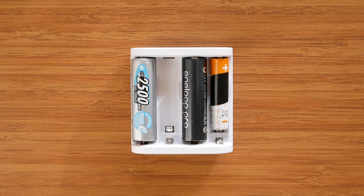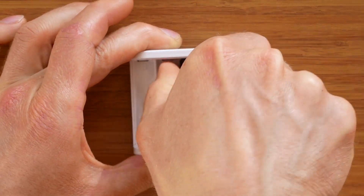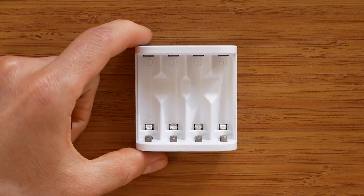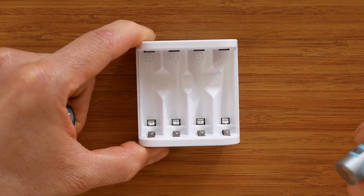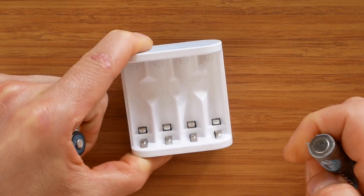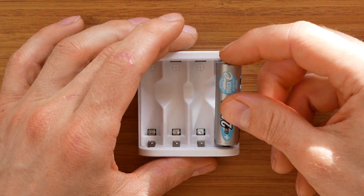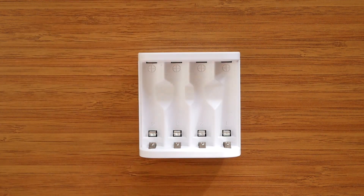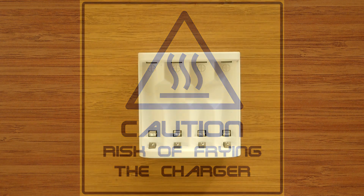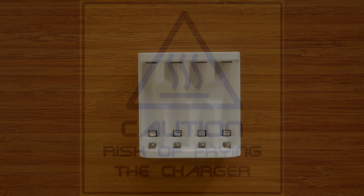At this point you might be wondering why I am not actually using the charger in the video. Well, that brings me to a bit of a warning. While testing the charger, I was trying to see if and how the reverse polarity protection works. It's impossible to charge a battery the wrong way around since the plus contacts on the charger are slightly recessed, so if we insert the battery that way, it simply won't work because there won't be any contact on that side. However, to test the feature properly, I inserted a small metal plate between the minus side of the battery and the plus contact, but unfortunately the A4 stopped working afterwards. I'm not sure if there is actually no reverse polarity protection or if I was simply unlucky, but I would strongly suggest avoiding testing that feature as it might not work as intended and it's likely it will fry the charger.